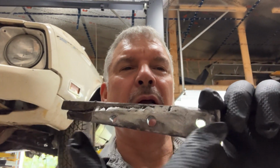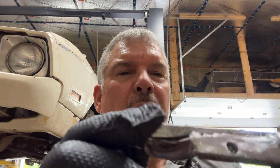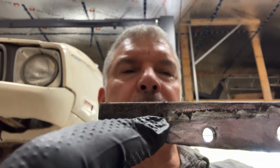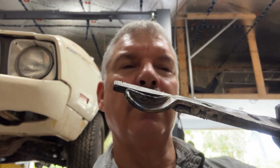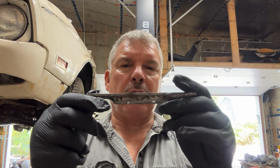But this is generally what I did. It's locking on me. I got the original bracket here, all right? And then all I did was get a piece of metal and weld it on. You can actually kind of hopefully see that. I cut it like this and then down, so there's a slot, so this sits inside there. And I did just some tacks and stuff like that. So this held really well. It didn't buckle, didn't move, obviously, because it's nice and thick now, right? And I did that on the other side. So that part of it worked like a charm.